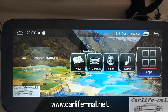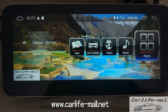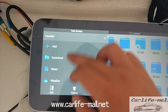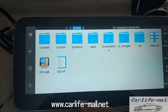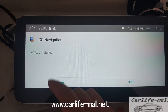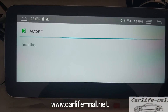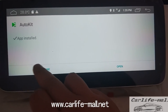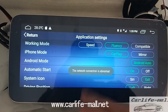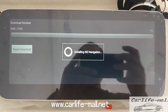Now we will install the iGo map. With the new CarPlay software version, clients can use CarPlay on another device. We change the card — the card will copy the iGo. Important: if the screen says some updates need you to format the card, never choose Yes — or you will format the card and need to download it yourself. Check the CarPlay software version. For navigation, choose iGo and click OK. Wait for restarting.